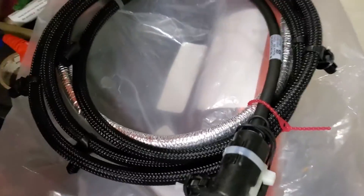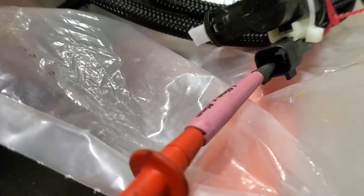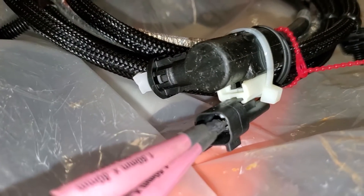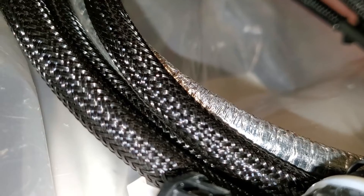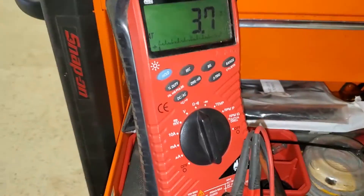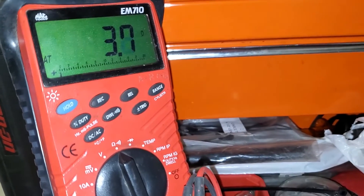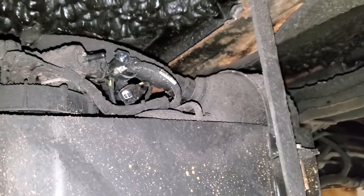Here's the new line, all bundled up nicely — kind of has a chemical rubbery smell. I've already got one terminal hooked up; let's get the other one on. Watch the meter. Our new line reads 3.8 ohms. You can see the difference clearly — the old line read almost 8k ohms while the new one bounces right around 3.7 to 3.8 ohms, well within the 3 to 5 ohm spec.